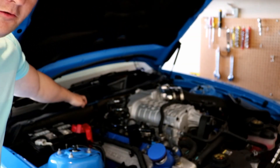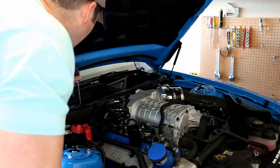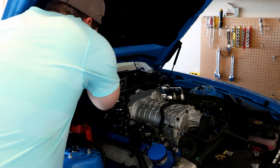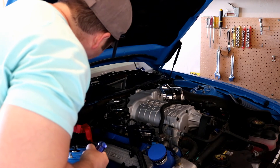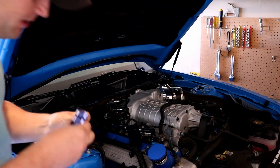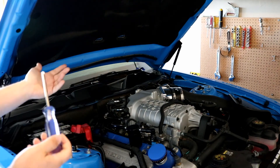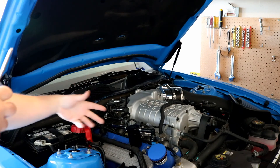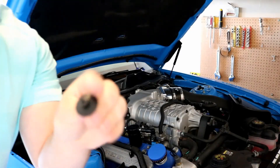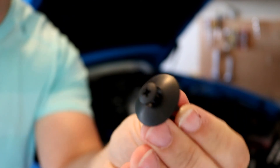To start off, there are just these two little push pins - they have a Phillips side on them so just screw them out to get the hole exposed. Take that out and take this out. This one is a pain to get out - try to twist it out but just pinch the bottom closed and then start screwing it out so it has something to grip. That's what the little push pin looks like.